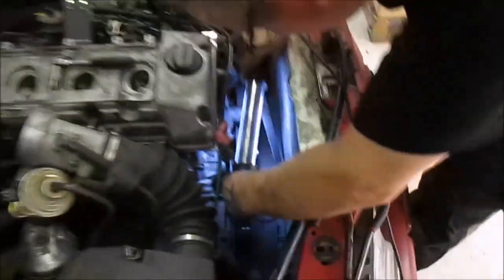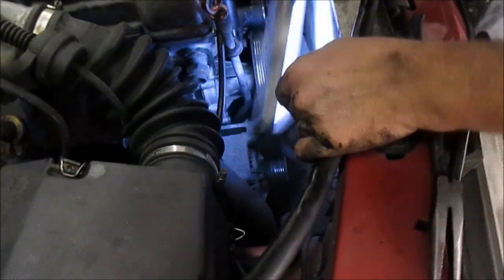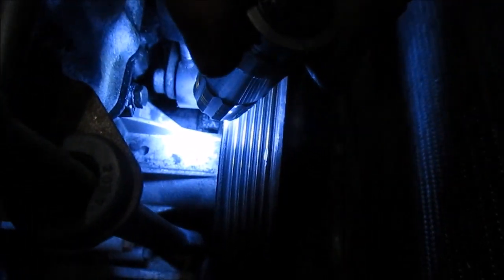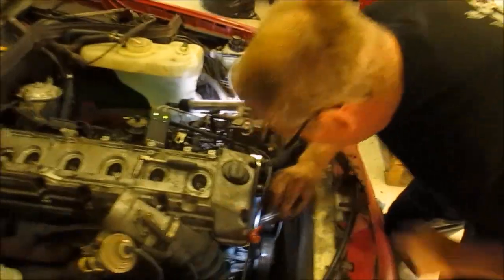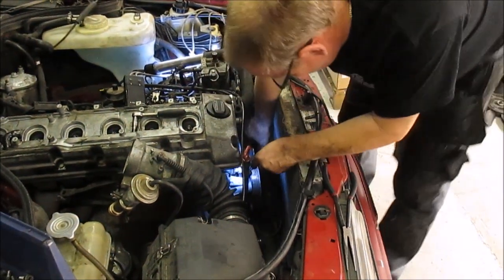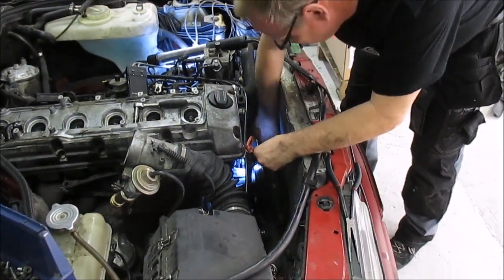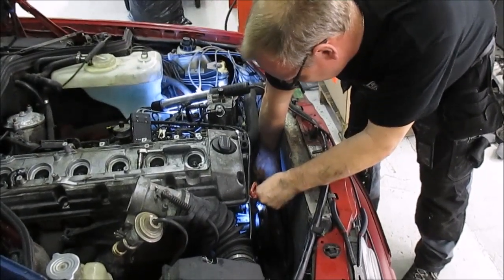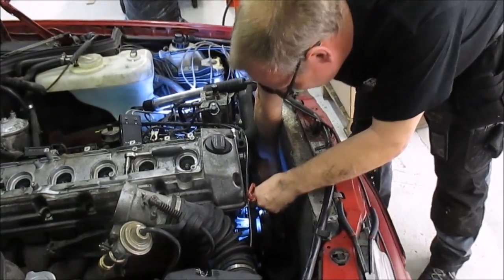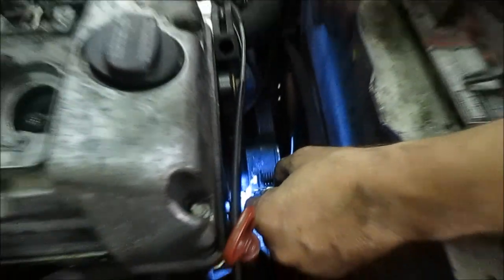At this point we have... I can see it, you can see it. Flashlight. 19 degrees after top dead center. But this pump that we are going to fit is going to be fitted 10 degrees after. So what I do is take the engine back and then go up again. Here we have 20... 10 degrees after top dead center. And there — we have it on 10 degrees. When I have the engine in this position.